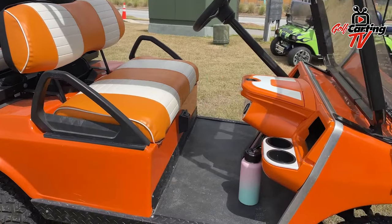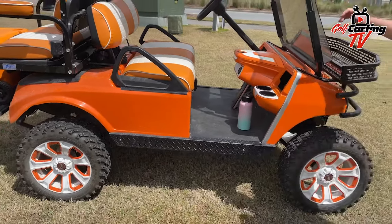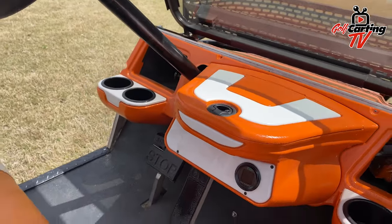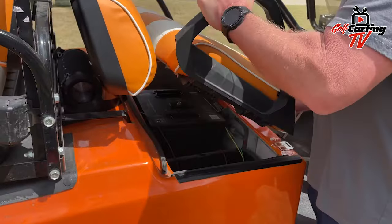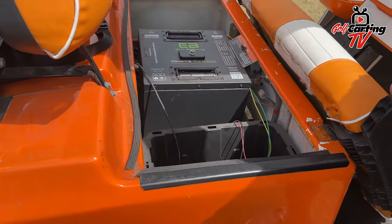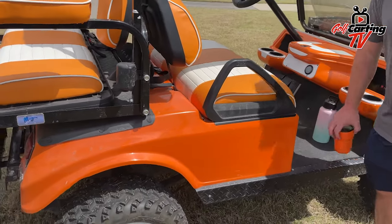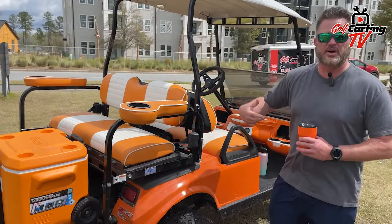Some of the work was already done by my buddy Matt Smith — he's a fellow Vol, a good old Tennessee fan. I fell in love with it, bought it off of him, and then over the last two years I've started slowly adding a little bit of my own twist to it. I put this dash system on it — actually, I'm still in the middle of bolting it up, you'll see I only have two or three bolts on here because I want to add a couple of accessories later. I took all the lead acid batteries off and converted it to an Eco Battery — lithium, a 48-105. I'm looking to get either a Navitas or an Eco controller to go a little bit faster.